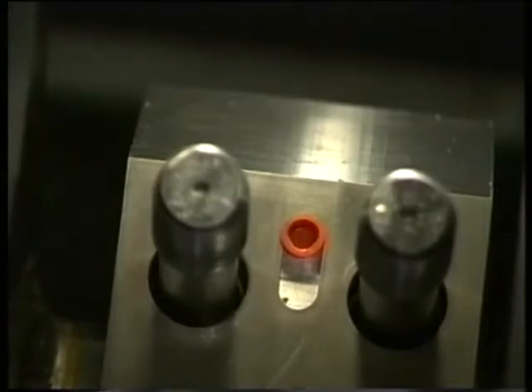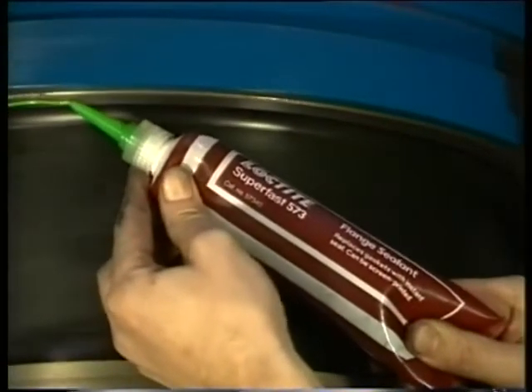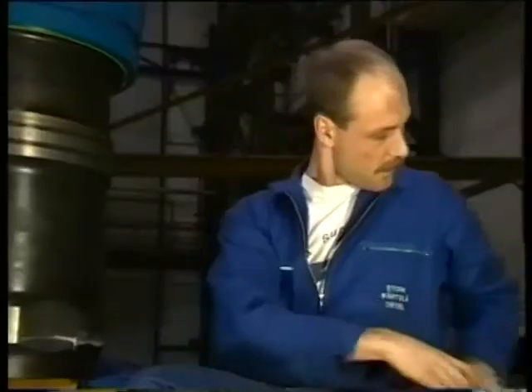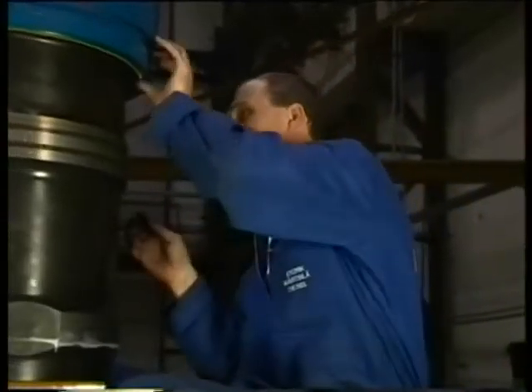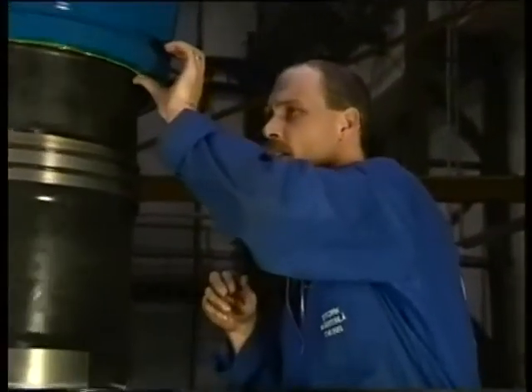It is recommended, however, to cover the complete bearing block. Now the liner can be installed. Lubricate the liner edge with the prescribed Loctite for joint-face sealing. Since the liner edge is lubricated, any dirt trapped on the sealing edge of the cylinder block can easily be removed because this edge is a dry surface.